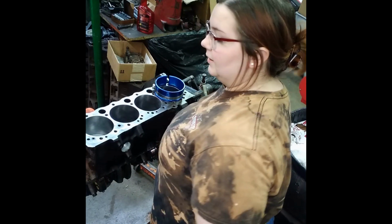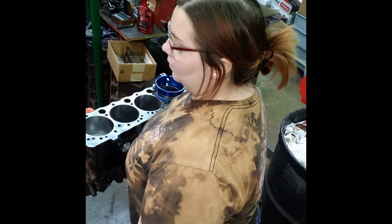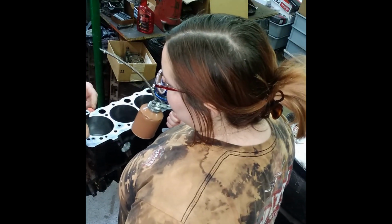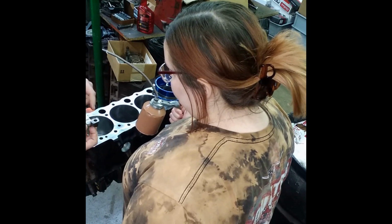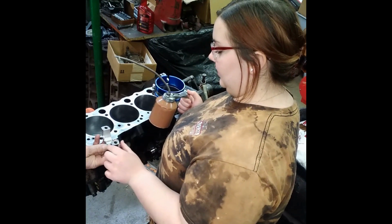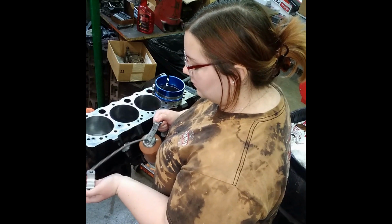Now, you need to take your cap and put them on them. And you need to oil it. Do the same thing. And make sure, look here. On a small block Chevrolet, the bearing tangs face out. You always want to make sure that these caps line up with each other. If you turn that cap around, it's game over. Well, number one, it won't go together. So make sure the bearing lock goes to the outside. Bearing locks go to the bearing lock.